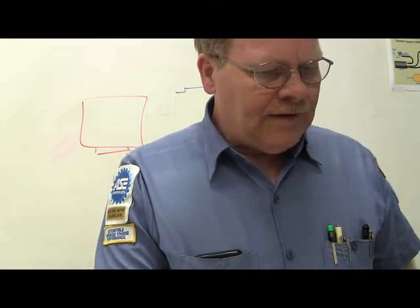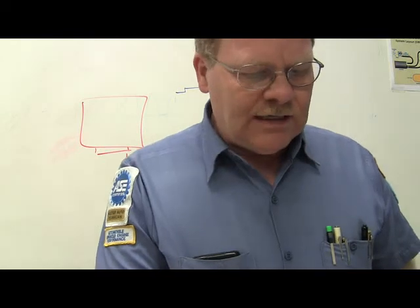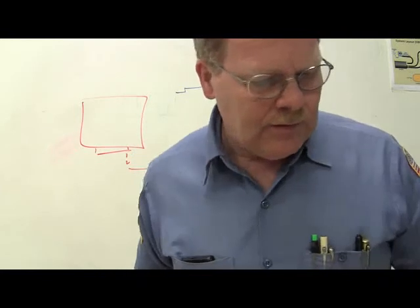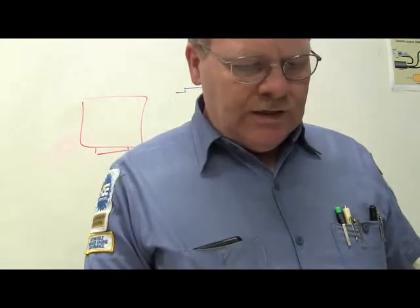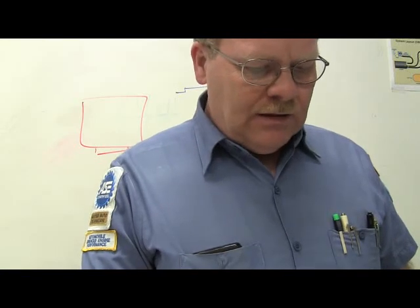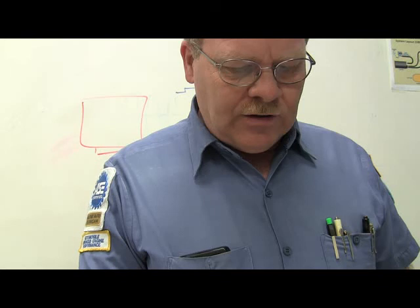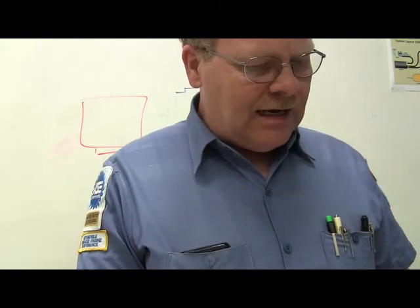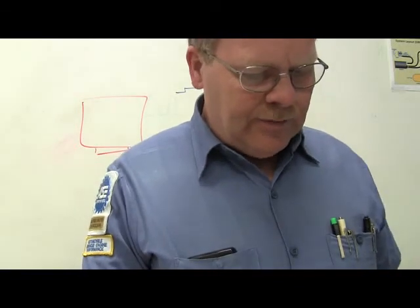Number 4, that was A. Number 5, what change has recently been made to the differential on the transaxle? Two-piece differential. Number 5. I got A. I got C. And D. How about D, the dog? Two-piece differential, right? And when checking clutch clearances with the input clutch pressure fixture, you're supposed to apply shop air to the fixture at how many PSI? 30 PSI. What do you think, y'all? 30 PSI.